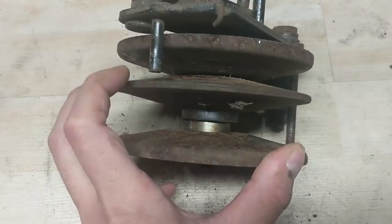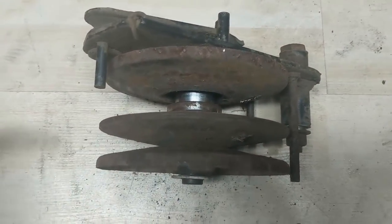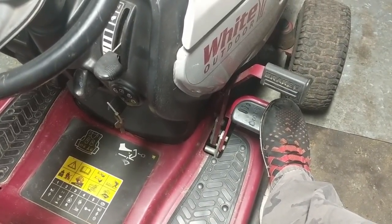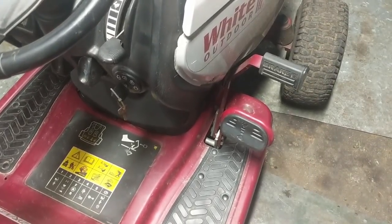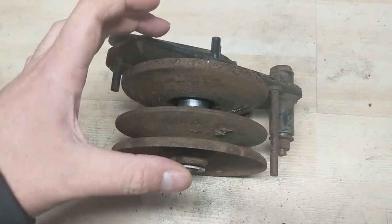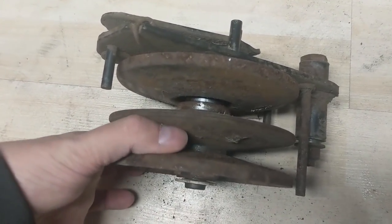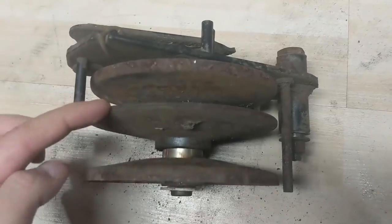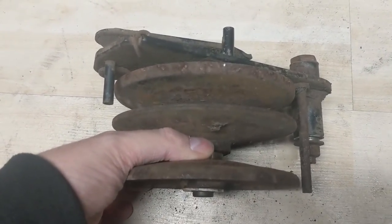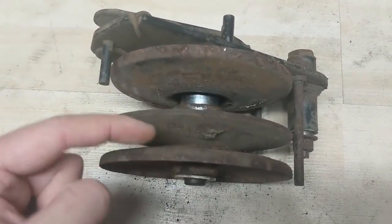This stack pulley has a centerpiece and you'll notice that it moves — it goes up and down. Normally, the harder you press your throttle the faster your machine goes, and when you let it go it returns to the resting position. When you press the throttle, an idler pulley setup puts tension on that belt, which pulls it tight against the pulley and raises the center part, pushing your top belt out. So you end up with a small pulley turning a much larger pulley — it relies on this centerpiece moving up and down to change your gear ratio.